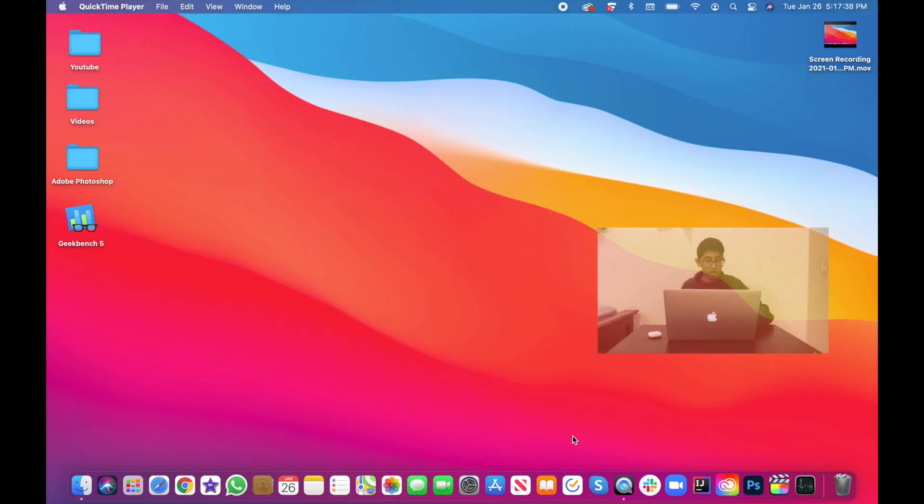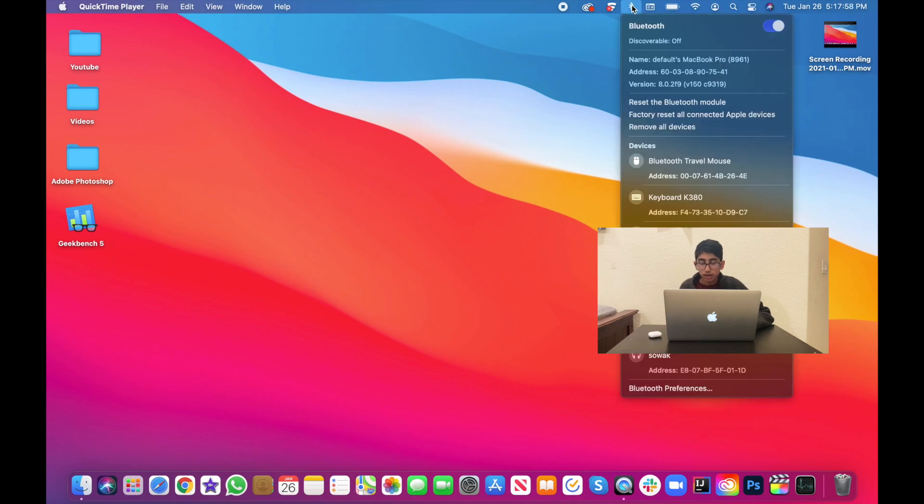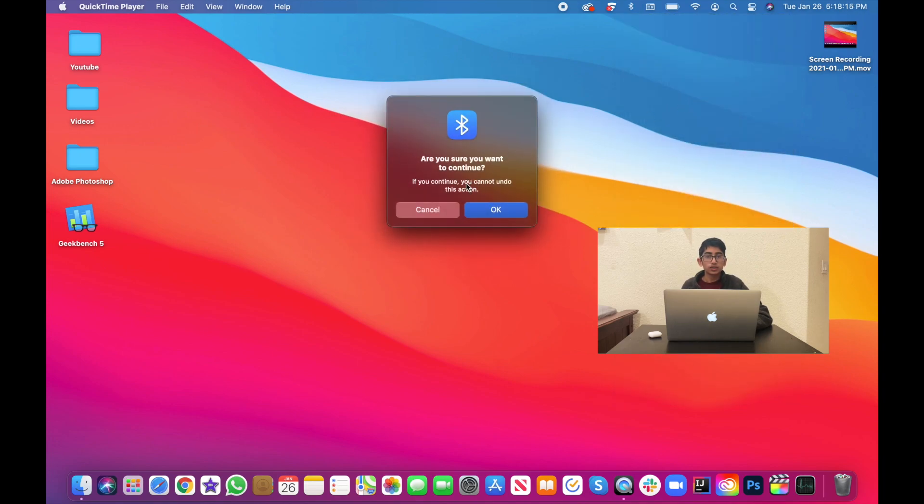The first step is to click Shift and Option — the two keys left and down to Z — and then navigate to the top of the MacBook screen, the darker bar, where you can see the Bluetooth icon. Click the Bluetooth icon, and you'll see a more advanced Bluetooth section. You can take your hands off the keys now. If you scroll down, you can see 'Reset the Bluetooth Module.' All you have to do is click that. What resetting the Bluetooth module means is that it's basically like you're reconnecting devices for the first time. So if you have an external keyboard, you would need to connect it back again once, and after that everything should run normal.